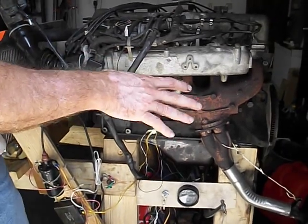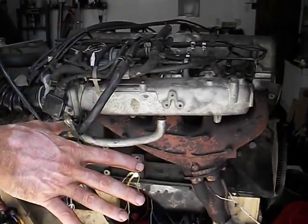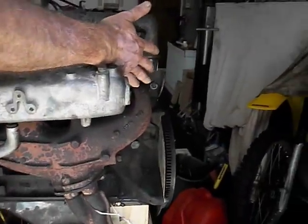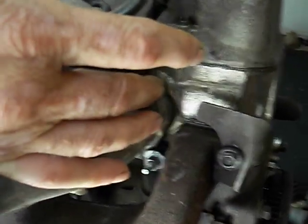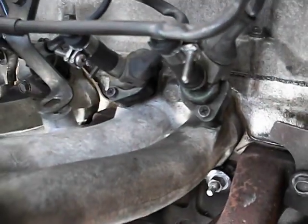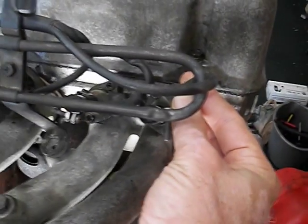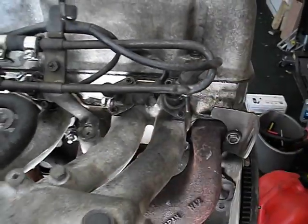What we're going to do here is try to diagnose a misfire. I believe it's injector number six, because what I've done is something called a power balance test — you run the engine and disable one cylinder at a time. I noticed that when I disabled cylinder six by pulling the injector plug off, stopping the fuel from being injected, it seemed to have no effect.